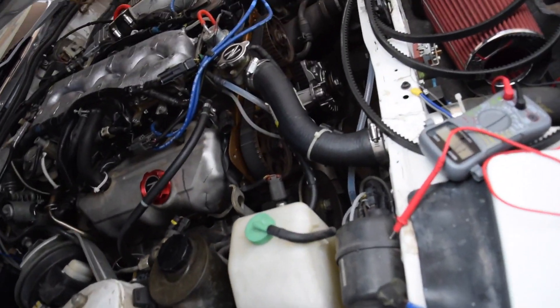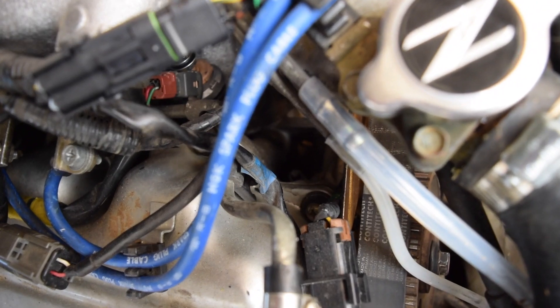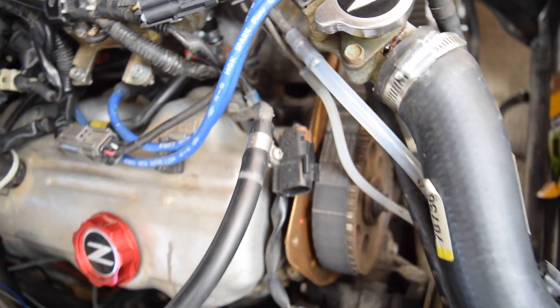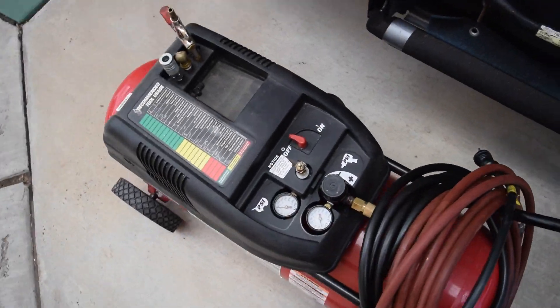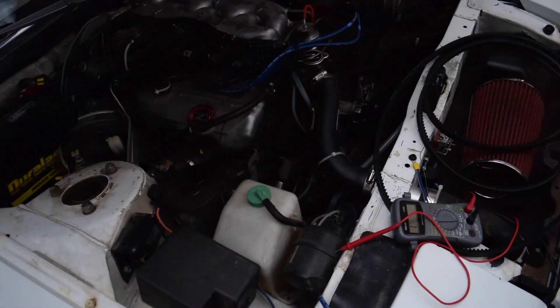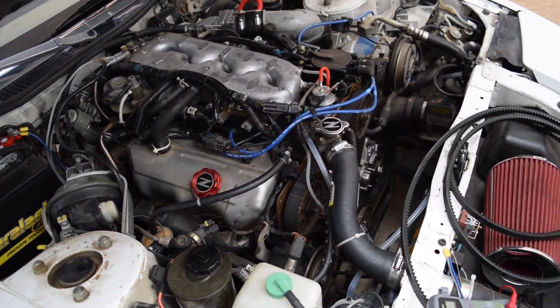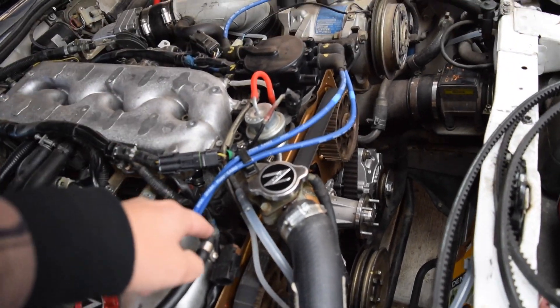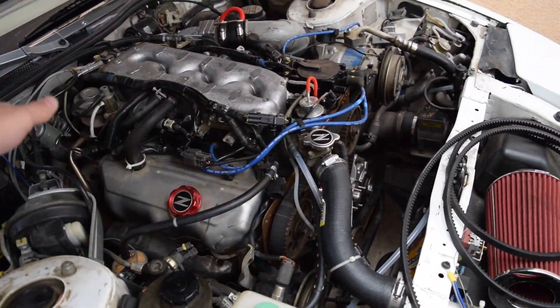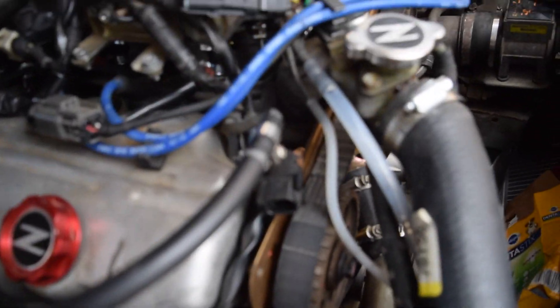If you take one thing away from this video for spark plug removal and installation: the spark plugs are down in very deep galleries and crevices, and dust and debris just fall in there. Do not remove your spark plug unless you take a compressor and blow it out first. You can also use a vacuum if you have a small enough nozzle. You don't want dirt and rocks to fall into your cylinder head — that'll score it up on the inside. I do one at a time: blow it out, remove it, replace it, then move on. Definitely do one at a time and be very thorough.